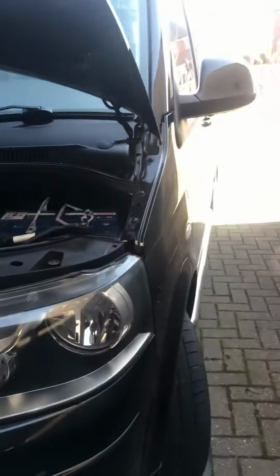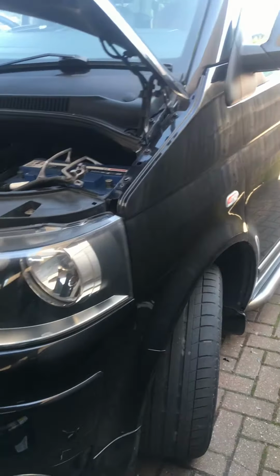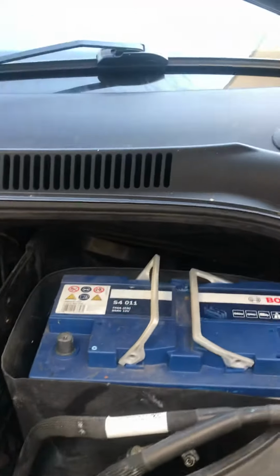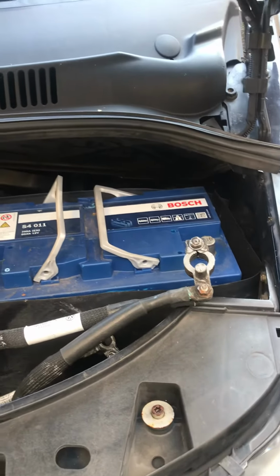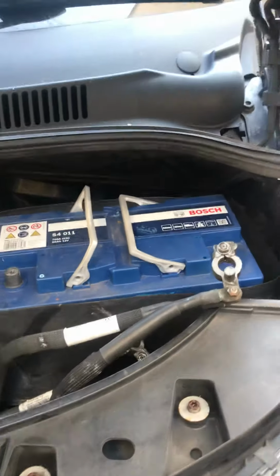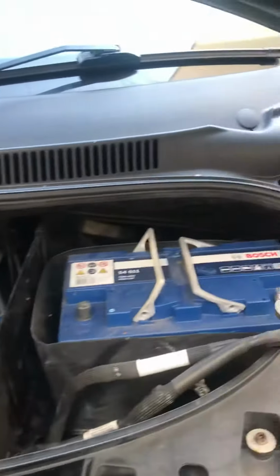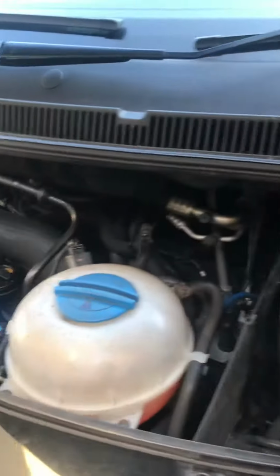Let's see, the problem I've had with this is battery loss. I've been waking up after about a week and the battery is so low. I did test the battery and it was showing about 12.6 with the multimeter when fully charged, but by the next day it had gone down to 11.6. So I'm hoping it's just a faulty battery rather than a problem with the vehicle losing power, like maybe because of the radio, etc.